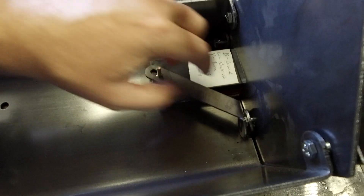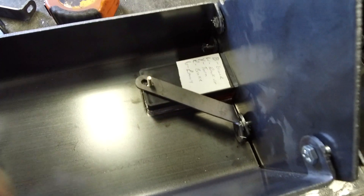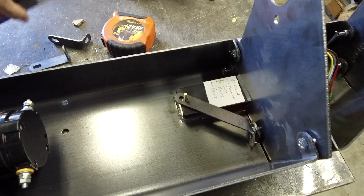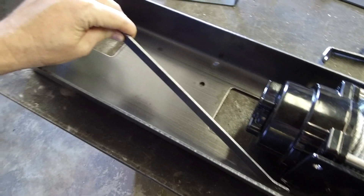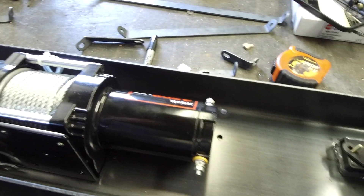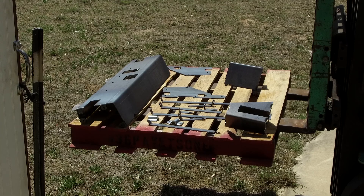I made these tabs that bolt into the existing tabs I have right here, and that's what's actually going to hold the brake light in. I have strengtheners that come from here and bolt up to the mount, which will strengthen the D-ring. Over here I'll have this to strengthen the winch mount, so that should triangulate all the heavy stress areas. Using the tabs to mount the taillights in — this bumper is pretty much ready for paint without any welding.